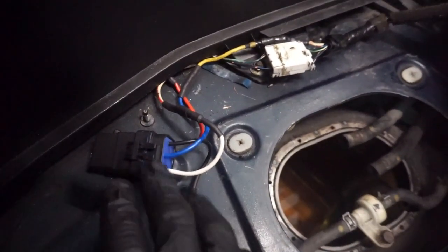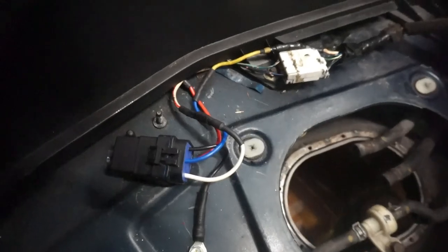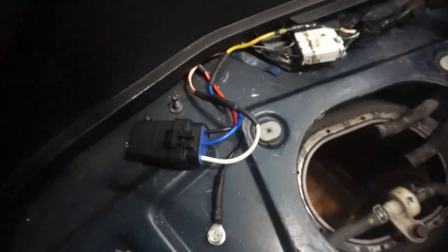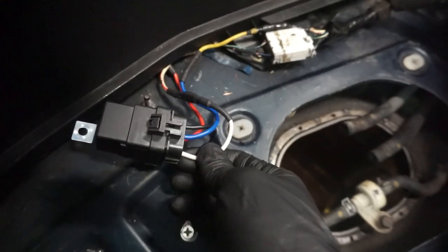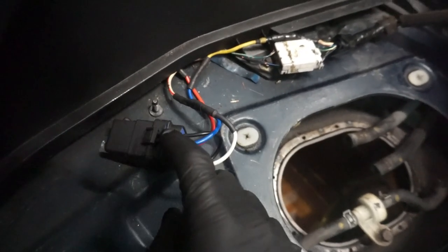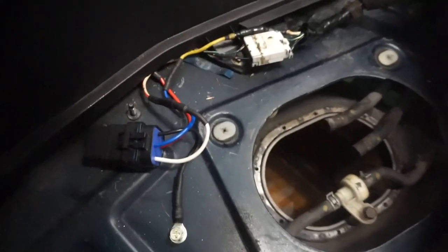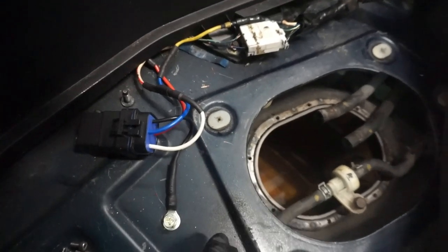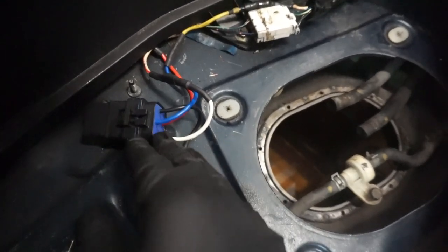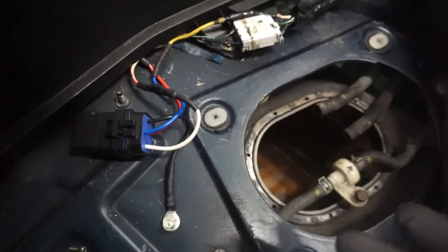On the car itself, what you'll have is the actual fuel pump wiring. Putting in independent relays is very well known to do. It's not some revolutionary new thing, but putting in an independent relay and having it power the pump directly off the battery is the preferred method. Same situation as the bulkhead connector on the hanger: the factory wiring just can't keep up. And by doing this, you'll also bypass the fuel pump resistor that lives under your brake booster. Left-hand drive, right-hand drive, it doesn't matter.